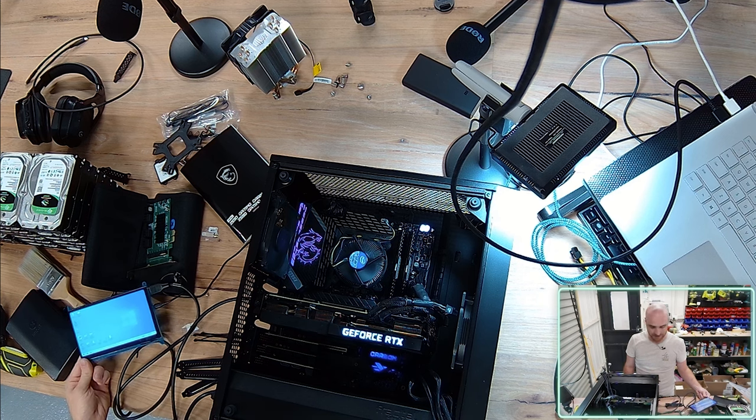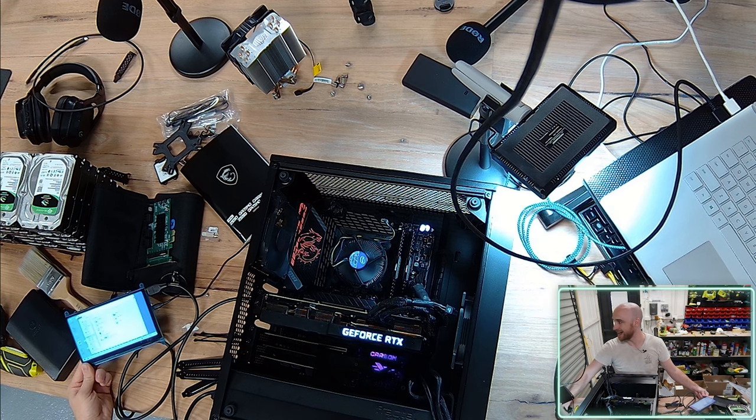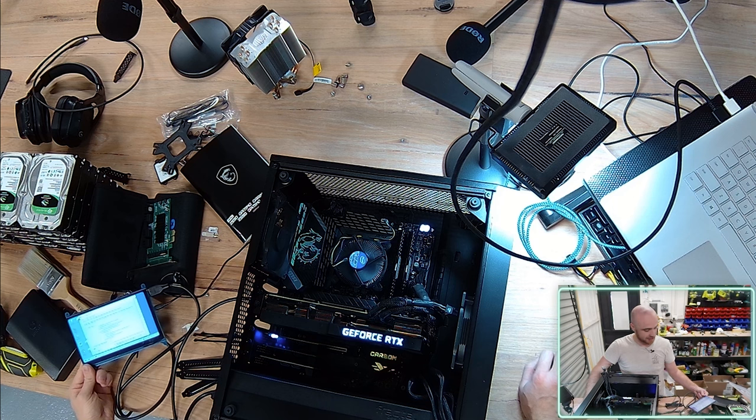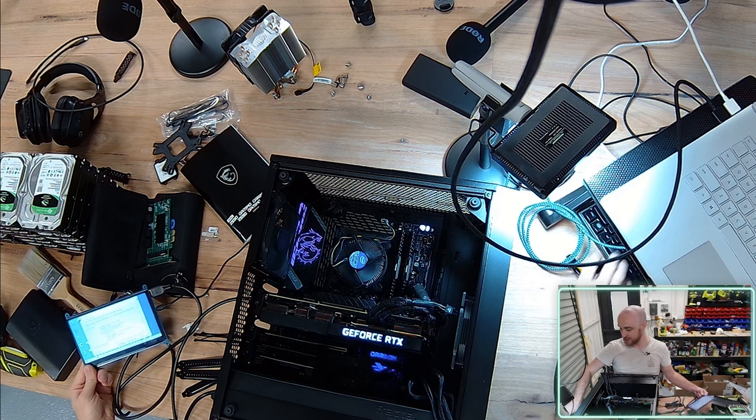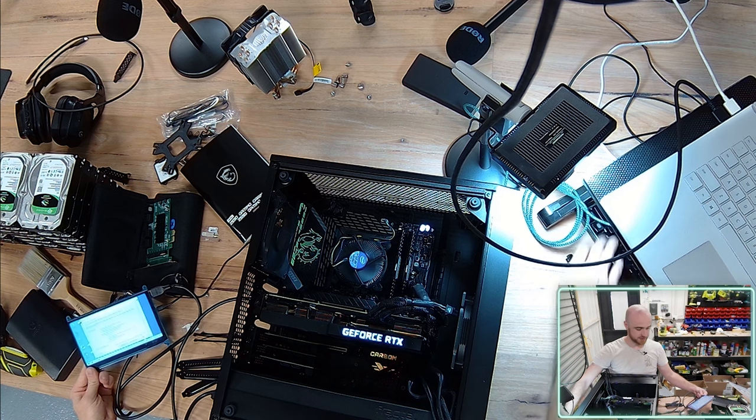Now it's all just about, I've got this connected. Going to Windows R, typing in DX Diagnostics. It's recognizing the CPU and 32 gigabytes of RAM, but isn't recognizing my NVIDIA graphics card because I haven't installed the NVIDIA drivers. So that's the next thing for me to do.